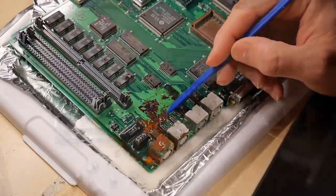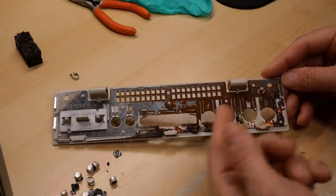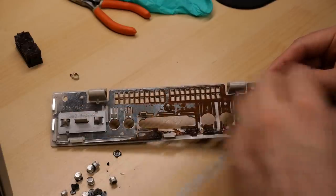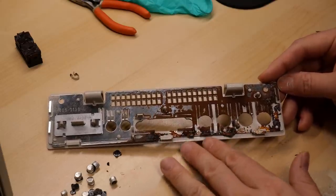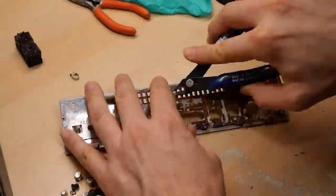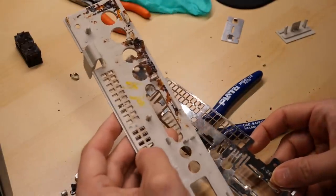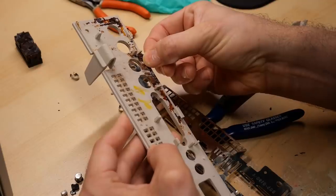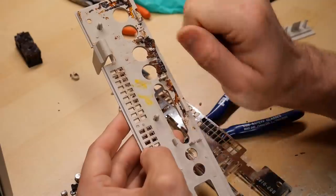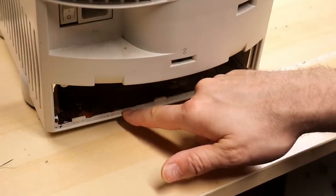Look at that chunk just came right off there. For the back cover, there's no saving this RF shield — in fact a lot of it in this section is just completely gone. So I'm going to cut these plastic heat stakes off, where they melt the plastic, and just pull that shield off. Then I can scrub this back plastic cover so at least it's not covered in rust. There's the RF shield — big chunk of it just missing. I think this part here will be able to be cleaned up with a wire brush. At least make this plastic clean. I'd like to allow you to see the carnage inside here from the leaky battery — I'm going to have to manually adjust the camera for this.